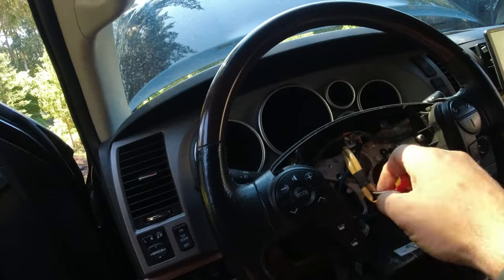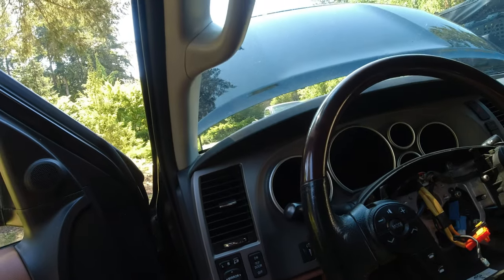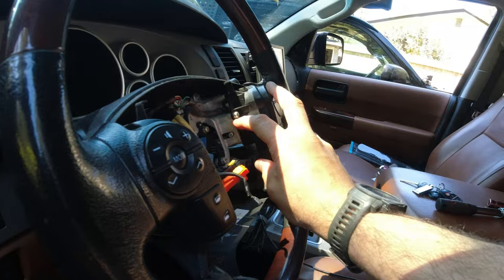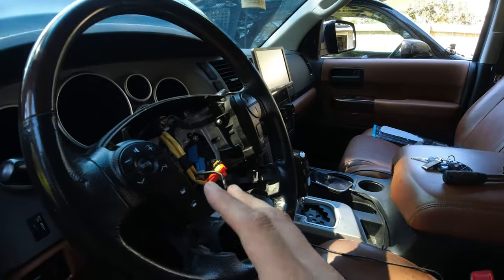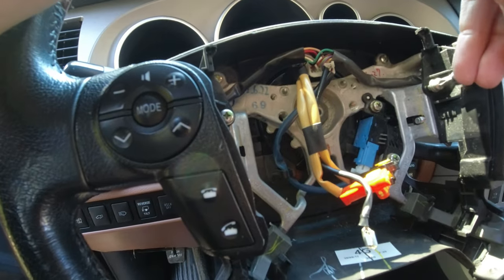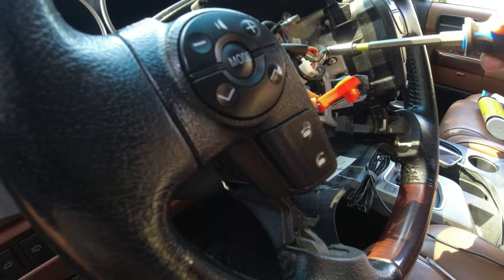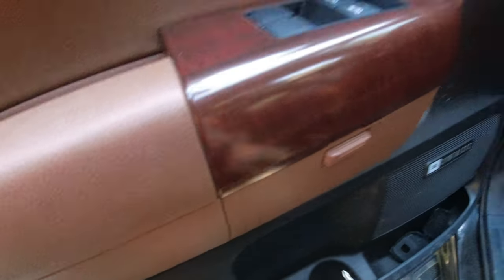Now in order to get the rest of the steering wheel off, there's a nut here that pulls forward but there's also a bunch of connectors. I want to get these connectors off, and I know there's a screw there. I'm going to start pulling these screws and see if I can get this off, and then I can compare the steering wheel I got to make sure everything matches up. Screw number one is out — I don't want to lose these. There we go — pop that out, easy.